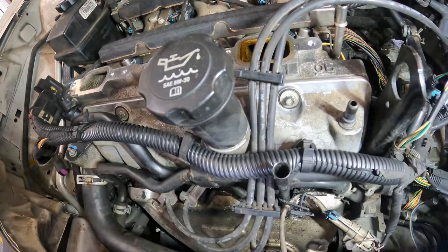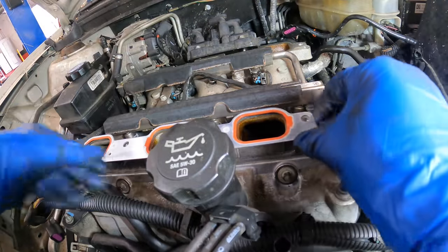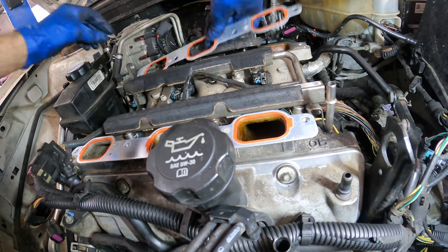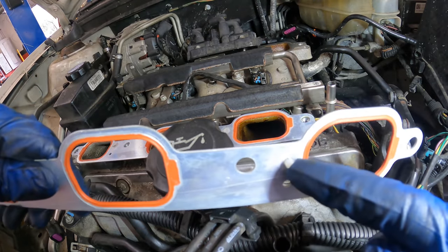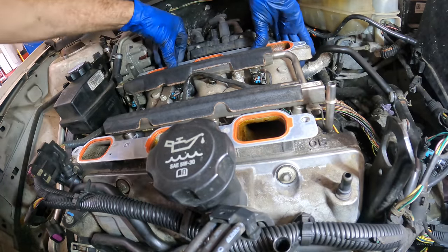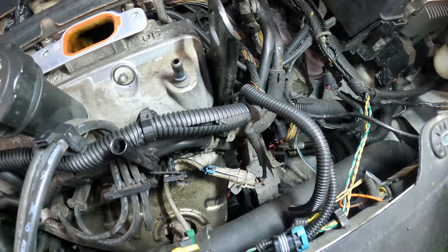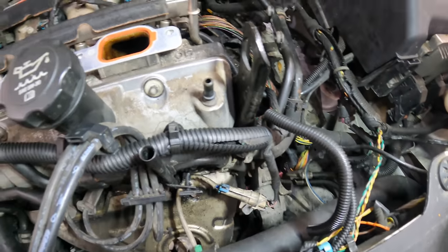Okay, there's an improvement. The intake manifold, the upper manifold, is almost ready to go in. So let's put these gaskets in place. And they're located with little tabs right here that press into holes that are drilled in the lower intake. Keeps them from sliding around. Flashlight gravity.